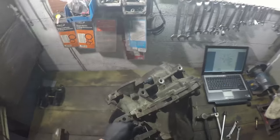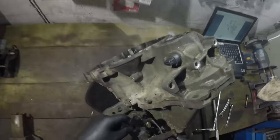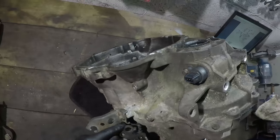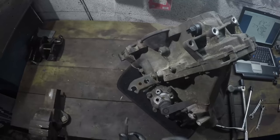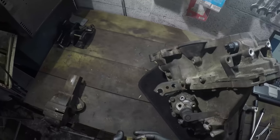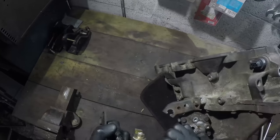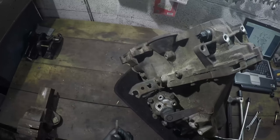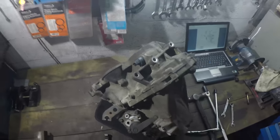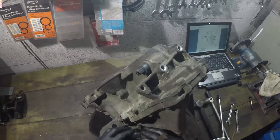The shift lever comes out. There are two parts here: one main lever which has a nylon bush that sits inside that groove. When I remove the shift lever you'll see its operation — it simply moves this in and out like so. That's got nylon bushes too. Has it got play? A little bit. I'm not too worried about that because its main operation is to move in rotation, not up and down or at any angle. So I'll leave that. I'm going to put the bolts back where I got them from, then the next thing on the instructions is to remove the speedo gear.